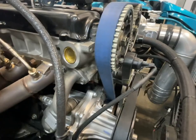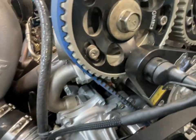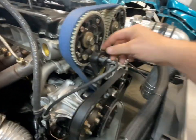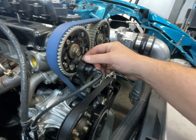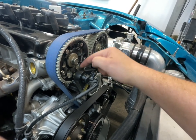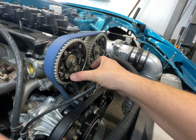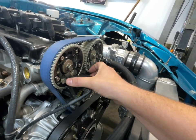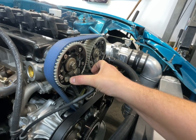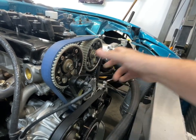But if you look, again, it's not complicated. You have two mounting points. You have one beefy billet bracket. You want to create something that doesn't have a ton of deflection. Well, no deflection, because you don't want this sensor to move and walk back and forth while it's trying to pick up signal from that cam sensor. You want a clean, sturdy, durable, long-lasting, everlasting gobstopper. I'm trying to think of other adjectives I could use. Sensor mount. You don't want to do some floppy dingle-dong version of this.